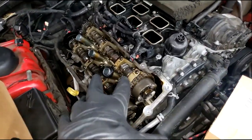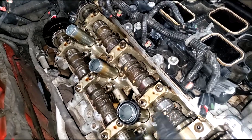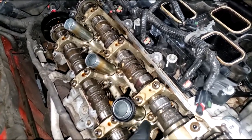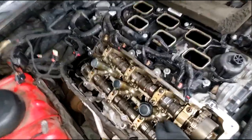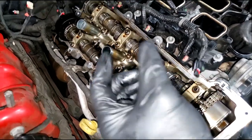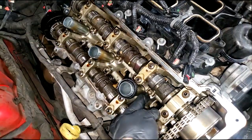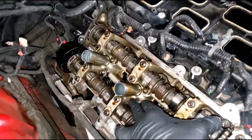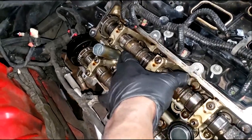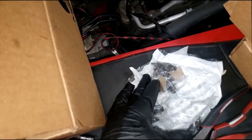What I've been authorized to do is repair this side. How do you go about repairing that? I'm going to replace everything that has come apart - replace the camshaft and do all the rocker arms on this side. As far as lifters go, a lot of people always ask: should you do cam, rocker arms, and lifters? If the finances are there, yeah. But I have yet to see a lifter cause a problem. Lifters are funny creatures - they're hydraulic, they need oil pressure to pump up, they have to stay stiff to do their job. It's hard to really test a lifter, especially if the car's been sitting - the oil drains back into the pan so they may feel spongy. I haven't had a problem out of a lifter, so I try to give an estimate on exactly what people need: 12 rocker arms and a camshaft.